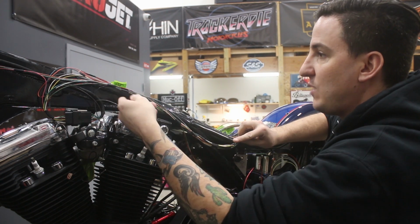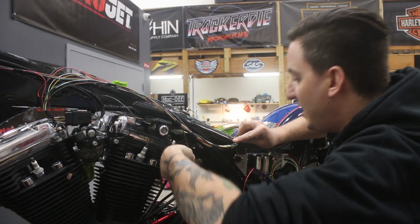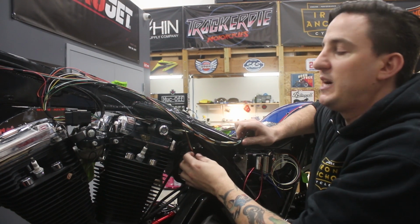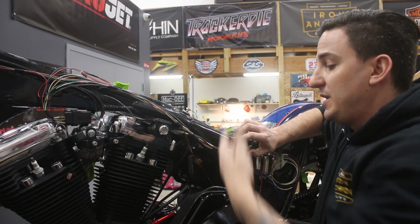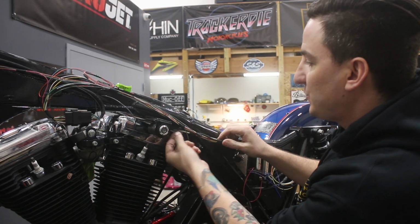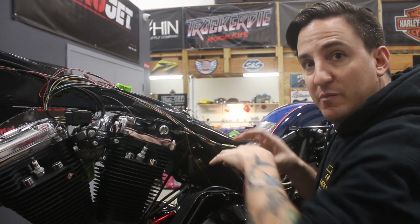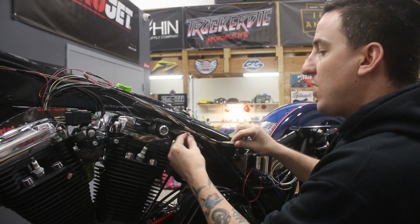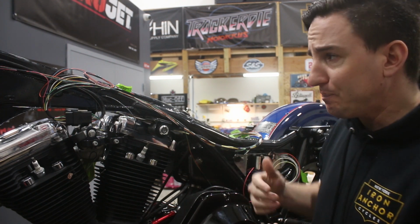And then you've also got some wires here that are coming down the left side of the bike, but don't actually go to the M-Unit. They're going to come inside into the battery compartment, and these are the pickups for the neutral indicator and oil pressure switch, which are on the other side of the bike. The tape, strategically placed, not only helps keep it all together, but when you go back to make the wire loom and build this into a finished harness, you know where these wires need to exit and enter so you can get it all in the right place.